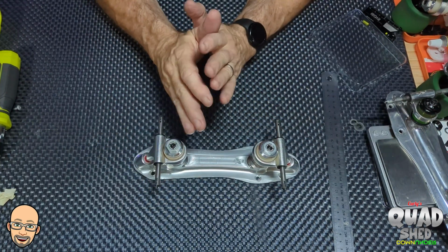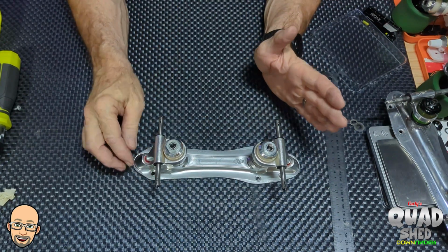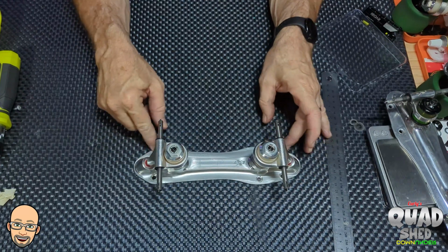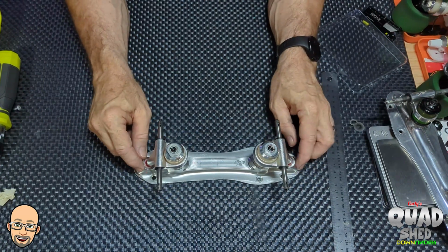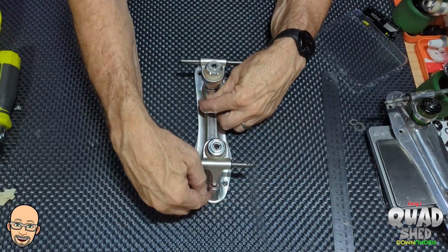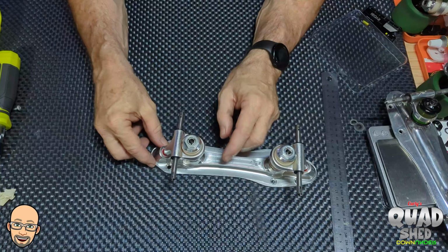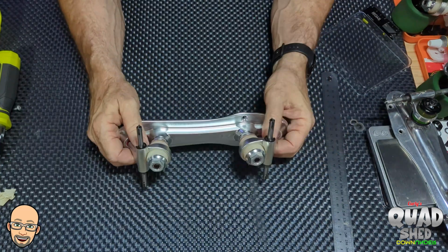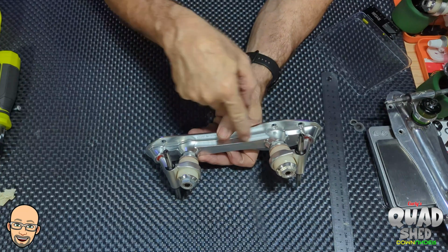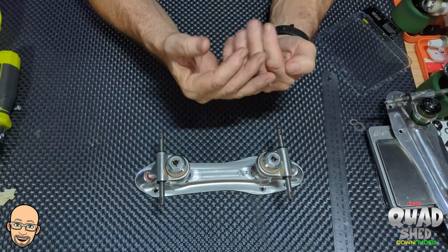So overall, like I said, I love the plate, but as for some of the limitations, I would put an extension on the back and reduce the size of the pivot pin boss at the front and also at the rear. You don't really need all that big chunky metal. Conversely, same around the kingpin. It's quite chunky around there. Overall, I would probably reduce everything down a little bit size-wise.